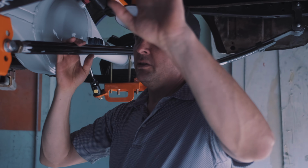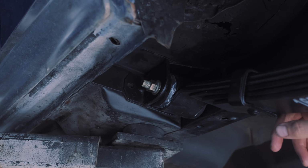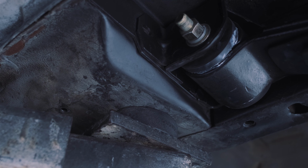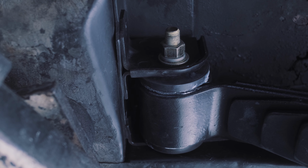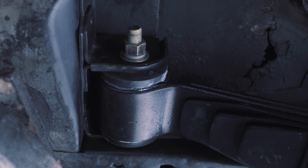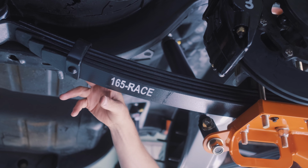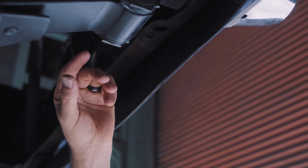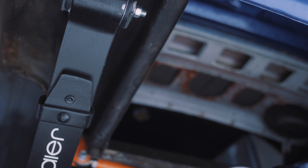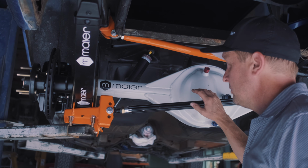So essentially we put in the leaf springs first and we position the front eye. We now provide the front bolts. As funny as it is, we didn't do that for a while, but we provide the front bolts. The leaf springs do not come normally with bushings, but if you buy the entire kit, then it comes with all the hardware. So leaf springs up here, the shackles here, it's just a standard rubber shackle. Put those in place and grease everything. Make sure that you over and extend all the grease. Just really make sure it's good with grease.